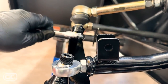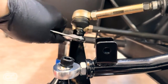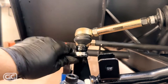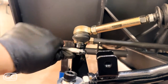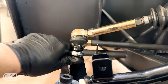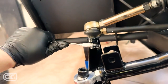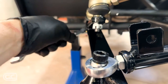I'll use 11/16ths — invest in a set of gear wrenches, I'll put a link on Amazon. I got the knockoff ones and they've been great. This joint is tapered so you don't have to crank on it — just get it nice and snug without ripping the bolt or the boot open. Do the same to the other tie rod ends. This may all need adjustment later depending on the wheels and tires I put on this cart.